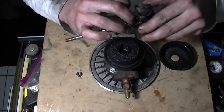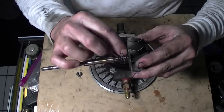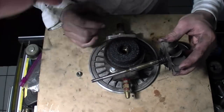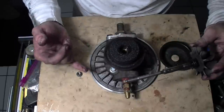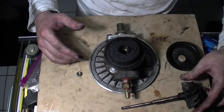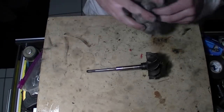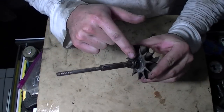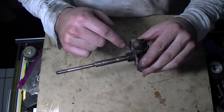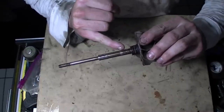Here's really what's bad — those are the piston rings I was telling you about. They're supposed to seal it so no oil exits, but they didn't do a good job. Make sure you don't erase your markings on the turbo. Clean this up a little bit, and make sure you get in here real good — clean out all in here. I went ahead and cleaned all this out because it was all gunked up with oil and you won't be able to fit it back in. The turbine shaft got pretty eaten up, as you can see, and you can feel those grooves.